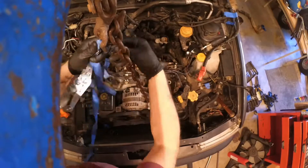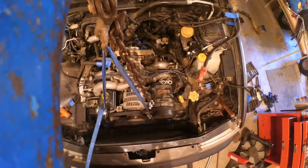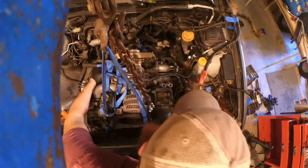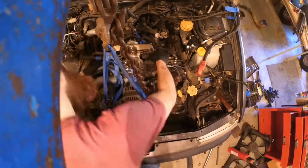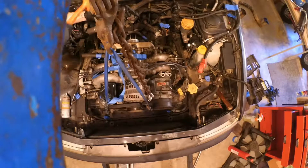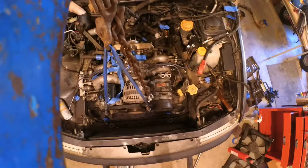These early legacy engines are really easy to pull because they still have the mounts attached to them that the factory used to install the engine. There's one on the front on the driver's side next to the alternator and one on the passenger side in the rear. To uninstall it, all you need to do is disconnect everything attached to the engine. Make sure you're labeling everything — it'll help you out later on.